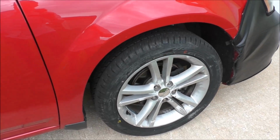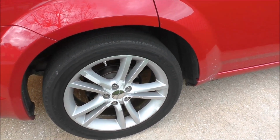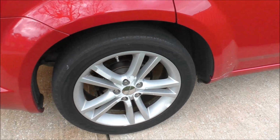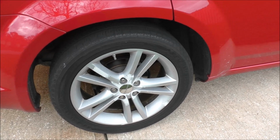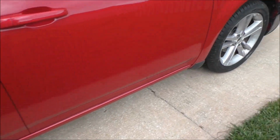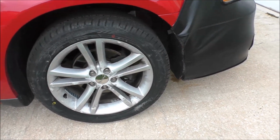Anyway, right now I'm just going to go ahead and do this myself in my driveway to switch the fronts for the backs, because again these still got some tread life left on them, but my concern is more about keeping those fronts as pristine as possible. There's less of some kind of alignment problem on the back than there is on the front, so there'll be less damage done. And I have an alignment appointment set up, but that's not for like a week and a half. People are so busy around here, you can't just go into a shop and get your tires aligned.